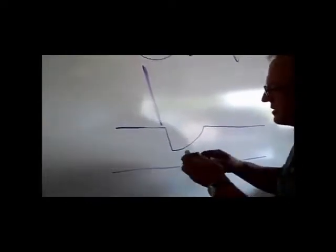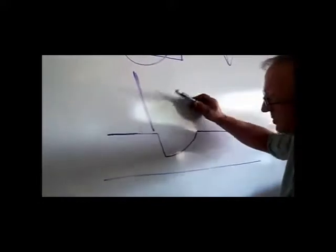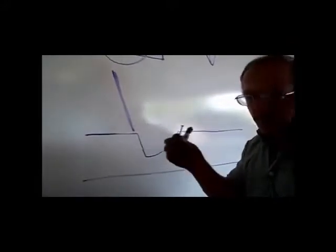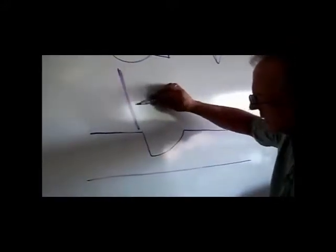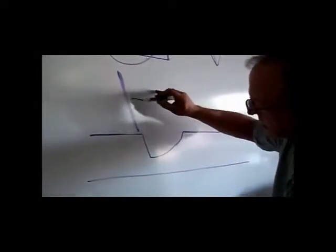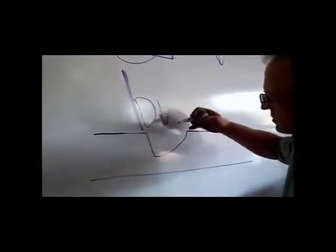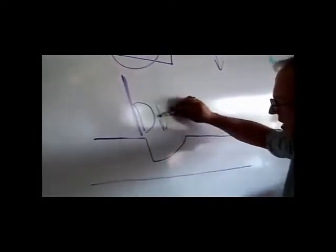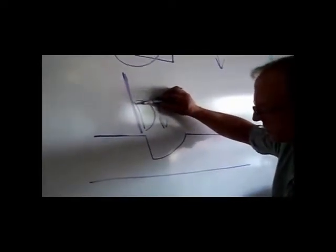So if you take the bit in your Dremel and you do this with it, which most people want to use like a pencil, right? No, because it's going to make your groove incorrect. The bit is shaped perfectly to create the groove. So what you have to do is when you put it in, you take the bit up against here, it'll be like this, okay? And then you move it down in that fashion directly. So you have to take it like this and move it this way. So you kind of lock the angle with the Dremel. You use the backdrop of the bit, you hold it straight, and you go down.